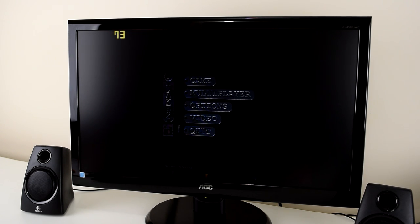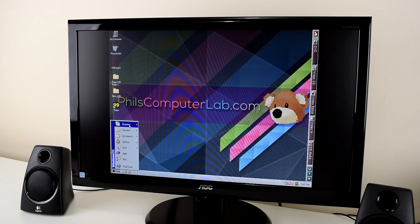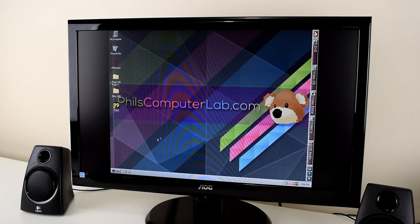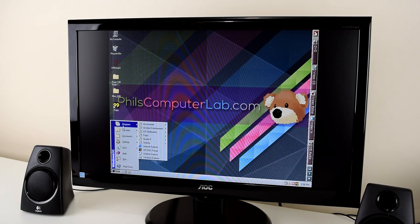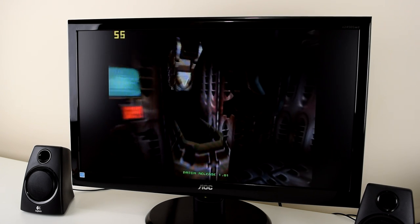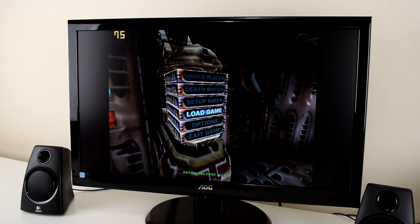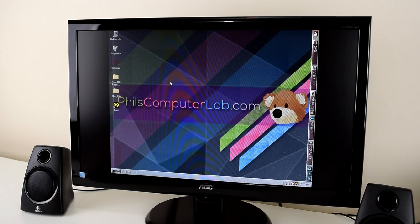Okay. Let's get out of here and let's try the same thing with a Direct 3D game. We've got Forsaken here. I just had to install the latest patch, it wouldn't work otherwise, so let's try it again. We're gonna play Forsaken, just a generic 3D accelerator, and we should get the FPS counter again. So this is at 640 by 480 resolution, so we can see it's got an FPS counter of 75, so again it's VSyncing with the 75 Hertz refresh rate.